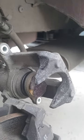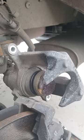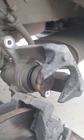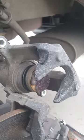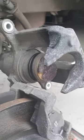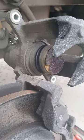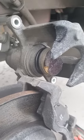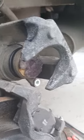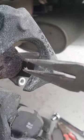What I have here is the back calipers on a 2013 Ford Taurus. On the front calipers, you're able to press down on the piston and it'll go in all by itself. With these back pistons, they are a little bit different, so you won't be able to press these back like you did the front. If you look at these two grooves right here, they're designed so that you can actually put in a pair of pliers.